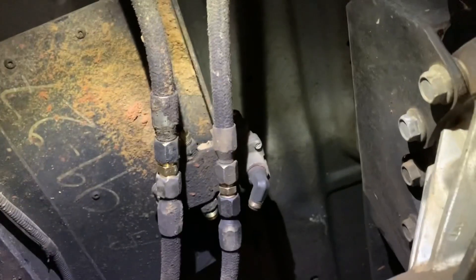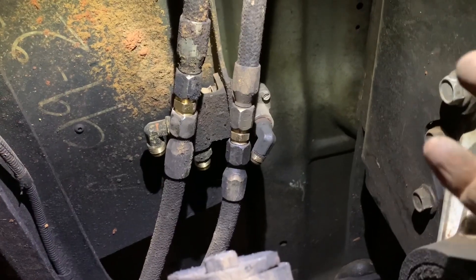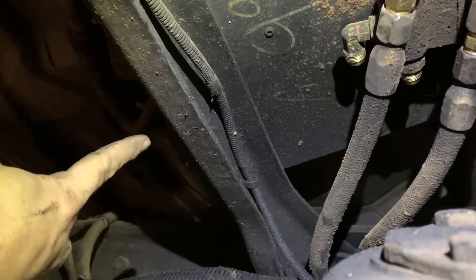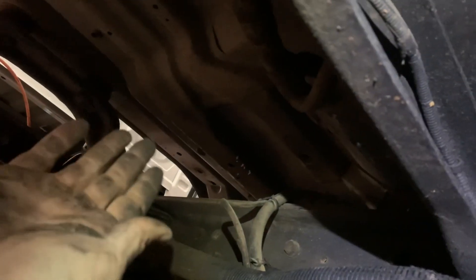Time to connect to the permanent tank — we've got a tremendous amount of slack from the new lines and the temporary union is in place. That little manifold block on the back side connected both left and right tanks and somehow always managed to equalize them — it's impressive because it's purely mechanical, no wires. All I did was put a union between the two to draft from just one tank while we worked on the other. Now I'm going to break that union free, fish those lines over that cross member to the other side, cut off the excess hose, put the fitting on, and reconnect it.